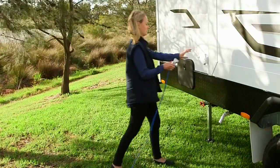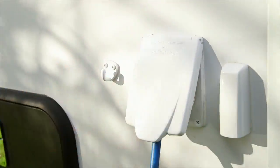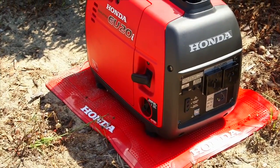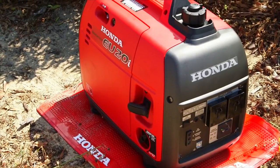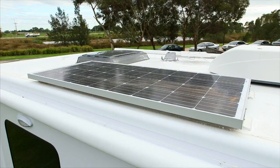It is imperative that your leads are 15 amps. This will allow you to plug in to a 15 amp site. Plug the mains power into the van's power inlet. If you are in a remote area or plan on travelling into such areas, we suggest that you talk to your dealer about a generator that is applicable to your van, or a suitable solar system if applicable.